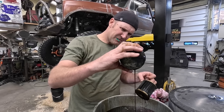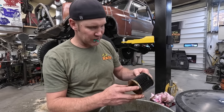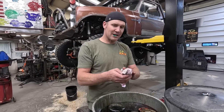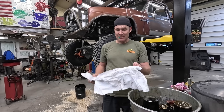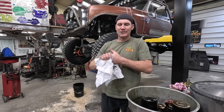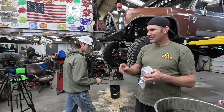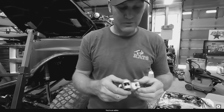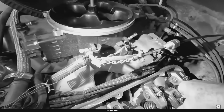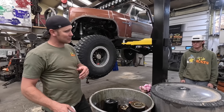A little shiny in there. I'm not seeing stuff in the oil that makes me really, really nervous. So it's a top end problem, but I can't have a tow truck that's not dependable and reliable. Motor's coming out. We're going LS power just because of its reliability. This big block will fix it — we'll put it in something else. Maybe we'll put it in Landon's junk truck that's always broken. This motor's got a curse on it. So this rocker fell off, was running on the valve, so I ordered some new ones. We tear it apart and we find this — there's another one broke right there. We're LS-ing it and we don't have to worry about the curse no more.